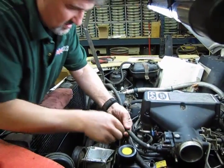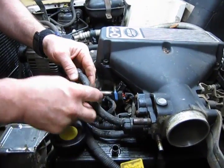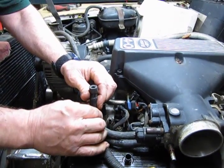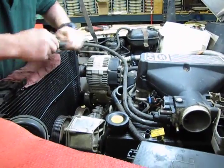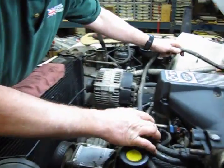Okay. Now, these hoses are a little swelled and soft, so after we get them off, we're going to replace them. And these can essentially be done with bulk hose. I believe these are a 5/16 inner diameter. They're getting a little dried out. Definitely time to change.